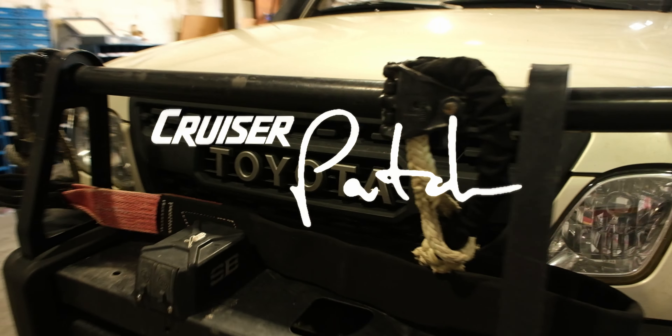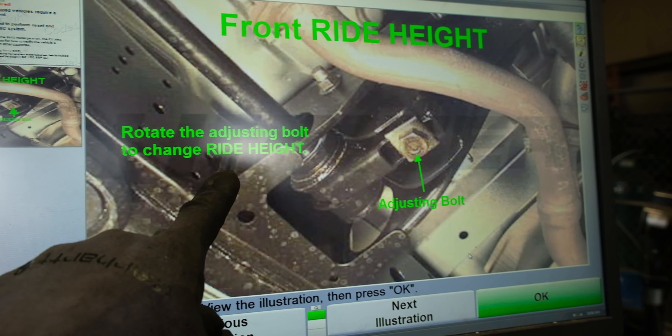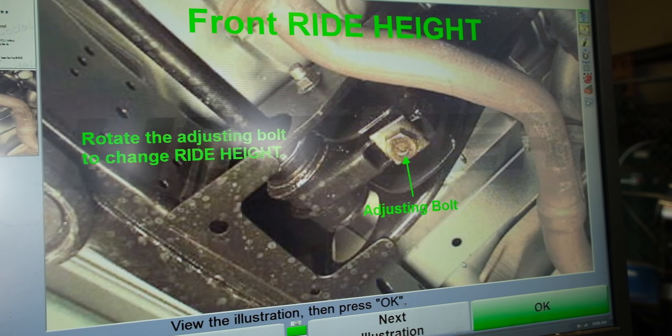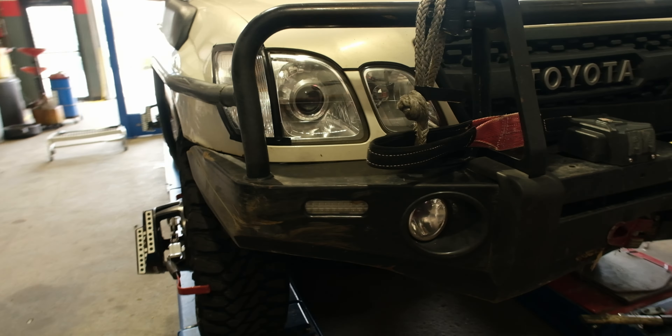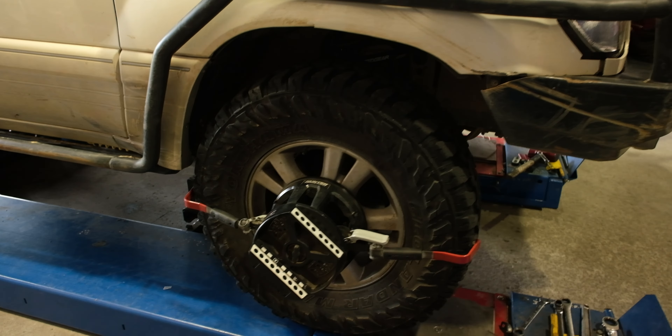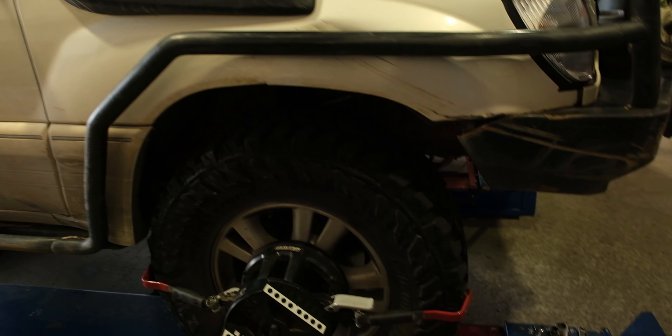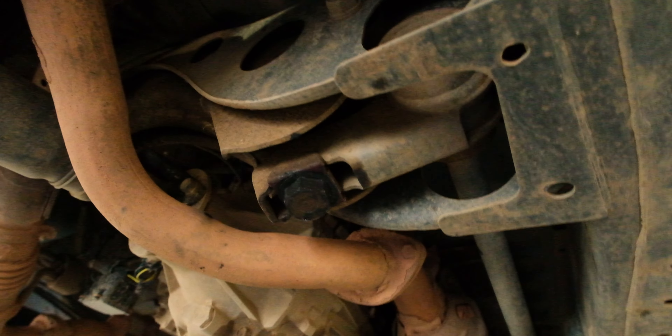Truck's on the rack — it actually already tells you where you can change the ride height. Before you put your truck on the alignment rack you need to make sure that your ride height is set. There's no point in aligning a truck if the ride height is off, and that applies to any vehicle, not just these 100-series with the torsion bars. These right here are the adjusting nuts — 30 millimeter bolt heads that you adjust your ride height with.